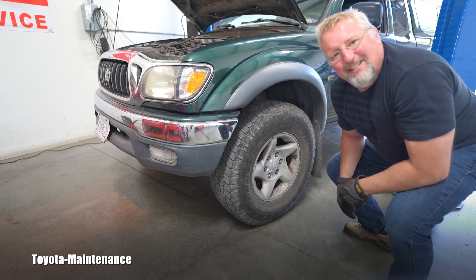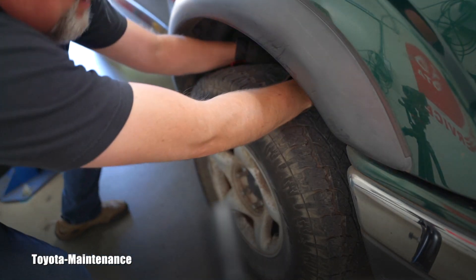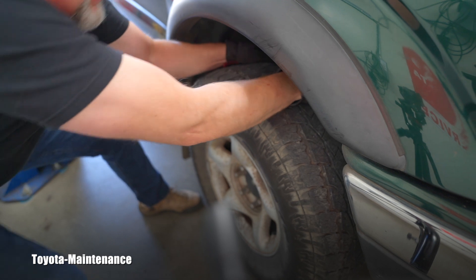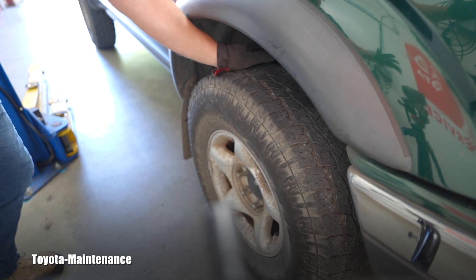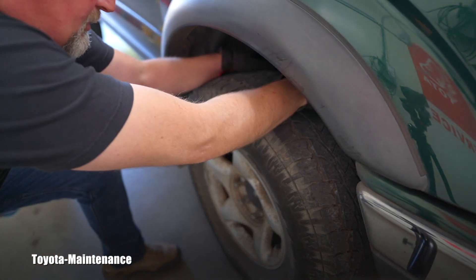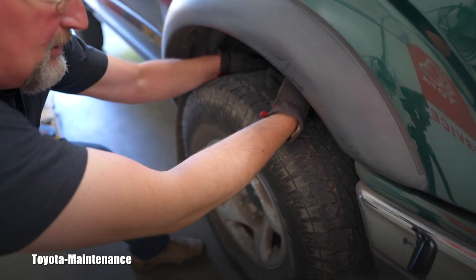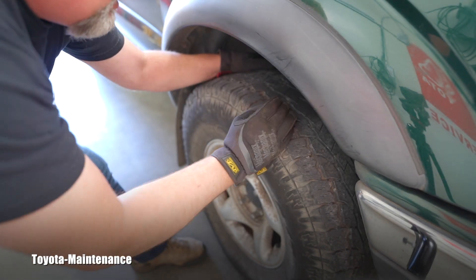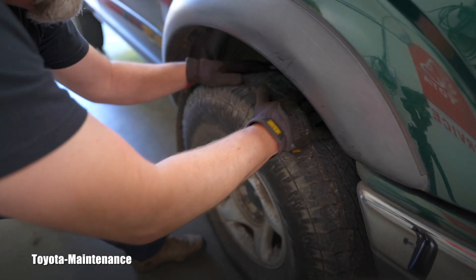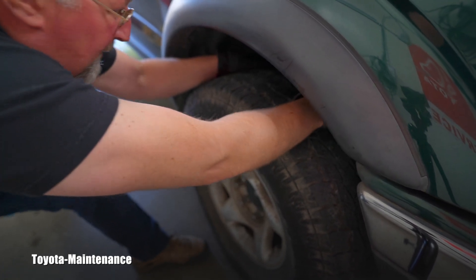Let's go and see the other side. If I do the same on this side — I'll grab it — let's see what happens. The neighbor started a forklift, that's poor timing. But basically, if this upper ball joint is bad — and I don't know if you can hear it — the wheel when I grab it moves towards me a couple of millimeters. I can also feel the knocking when I'm holding the rubber.